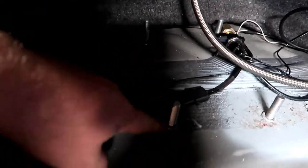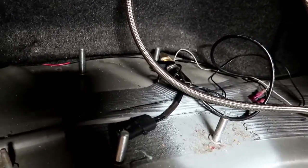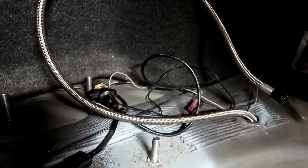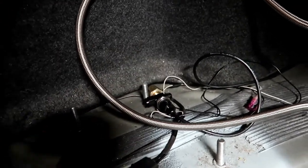That's how I have my nitrous bottle bolted in - using thread inserts and studs. If you don't want the nitrous in your car for a road trip, you just pull those out and it's nice and flat, no studs sticking out. That also makes it nice so you're not using bolts trying to find the holes through the carpet - makes the carpet go in super easy and gives you a minimum hole. All that wiring is for the heater and pressure sensor - bottle heater sensors right here.